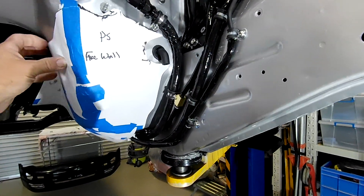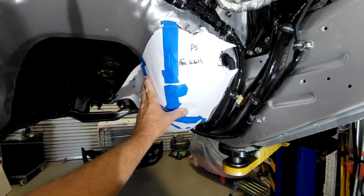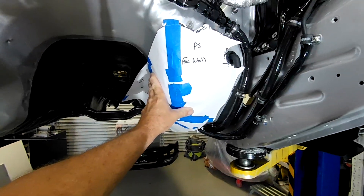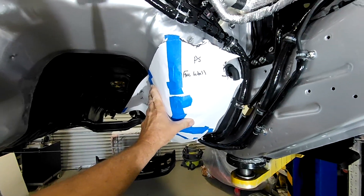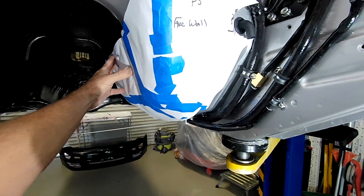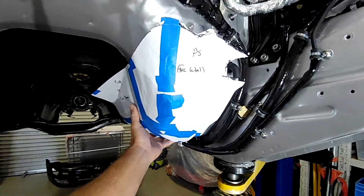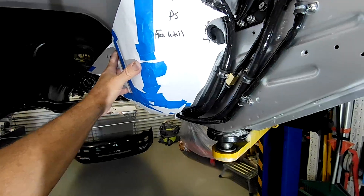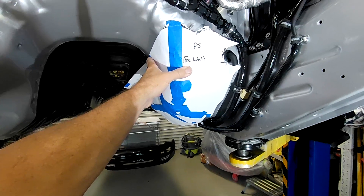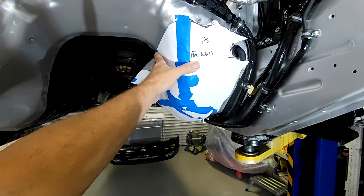What I've got here is I've made paper templates. I did this by getting paper, pressing it against the firewall and folding or cutting it until it's a tight fit, then securing the shape with masking tape until I get basically a boot that fits really well to the shape of the floor pan. I've done this for both sides. Now I'm going to take this out to the bench and work out how to get it to fold flat with the least amount of cuts.